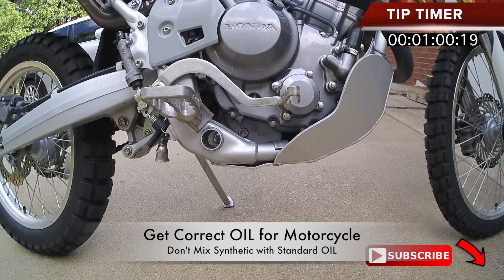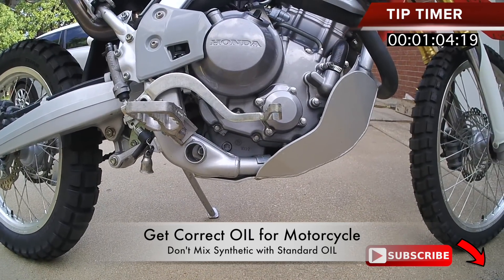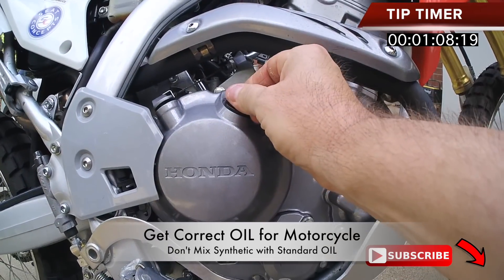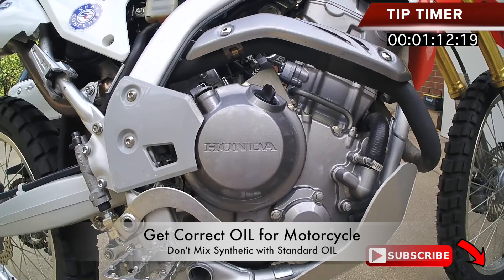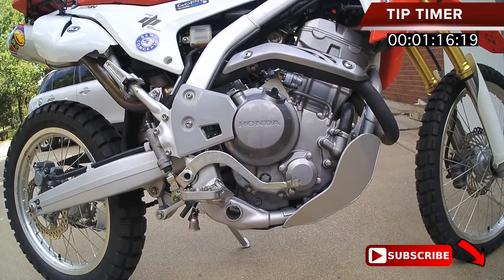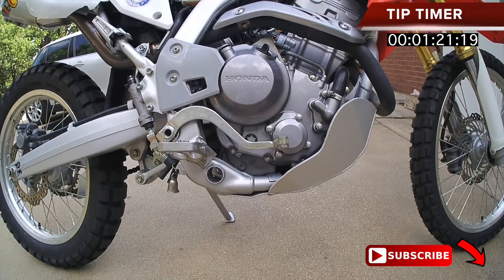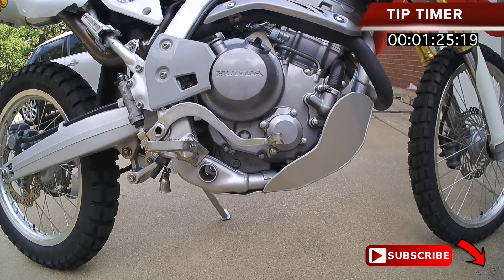You want to make sure you've got plenty of oil. If you're running a little low, AutoZone, O'Reilly's, Walmart — any of those places on your trip will allow you to go in and just get a little bit of oil. This is your oil cap. Every bike's a little different, so know your owner's manual. Open that up, put in the amount needed. Have a buddy hold your bike, or find a rock or stick to level it up. Put in enough oil and that's going to get you through the rest of your trip.